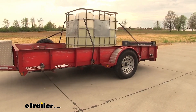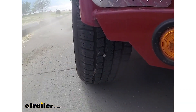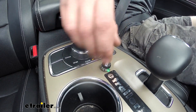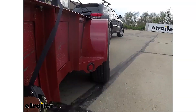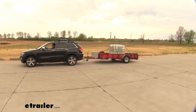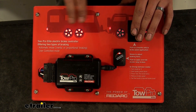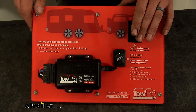For video purposes, we have our controller set so that our trailer brakes are locking up so you can actually see it working. You'll always want to make sure that your trailer brakes aren't locking up — you want to have them adjusted to the point of almost locking up so you have the most braking efficiency available. You also want to make sure they are set properly for road conditions and weather conditions, so if it's rain or snow, dial down the power a little bit so you don't have to worry about them locking up. You can see how with light pressure on the vehicle brakes, the LEDs are dim, meaning very little brake assist, while we have full power on our trailer brakes immediately.